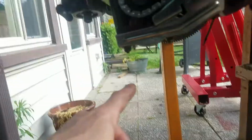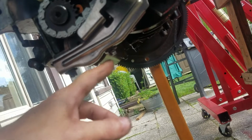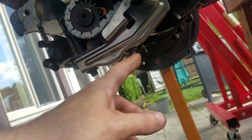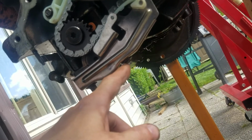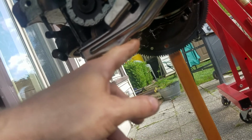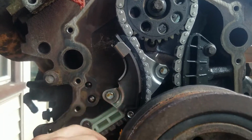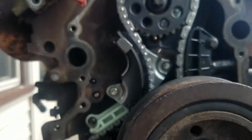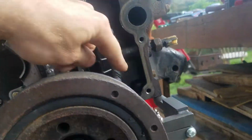These torque down, but I still don't trust them. I really don't trust them. I'm actually thinking about buying new grade 10 bolts and going in here and redoing that. It worries me because of all the other ones. Like these two were boogered, they were stretched. They cannot be used over again. Don't use them again. Just don't do it. Each one of these here, replace them.